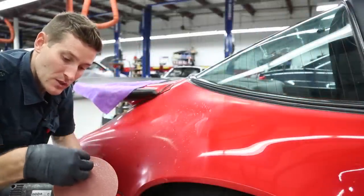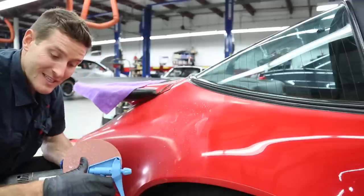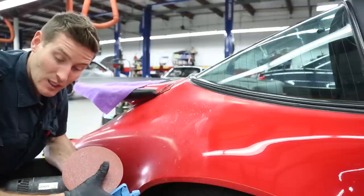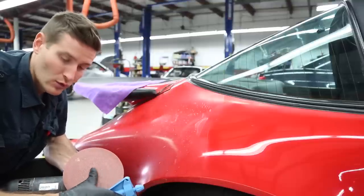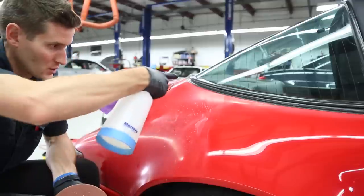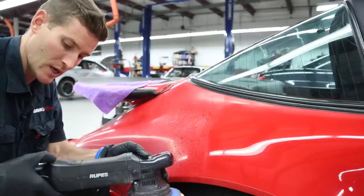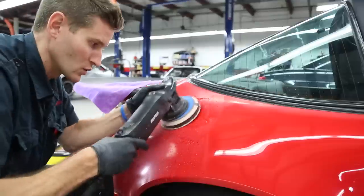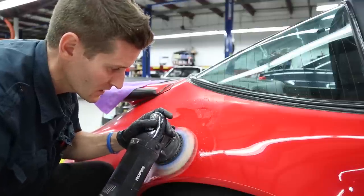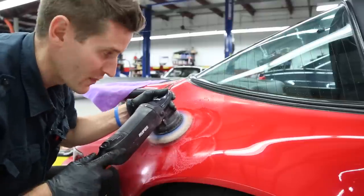Here are the steps to actually do it. This is 1500 from Meguiar's Unigrit with a foam backing plate. The way you prep these is not to dunk them in water, and a lot of guys use soap — those days are long gone. That throws off the cutting process because of the technology in these pads. What you do: grab your water, a few squirts, just make it damp. That's it. Then go to town — I put it on speed two and a half or three, you don't need to go too crazy. Light to medium pressure, slow movement, and you'll start to see this froth come out and it's all red — that's normal.